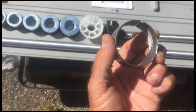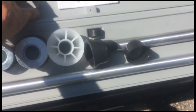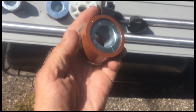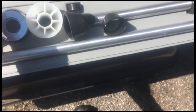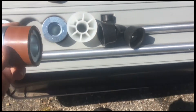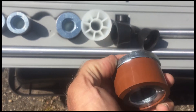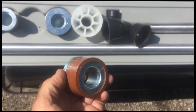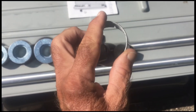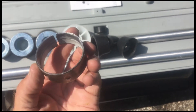These are thin bearings, by the way. There are two types, and for this tool there are two types of seals: the brown for thin bearings and the black for thick bearings. What it does is it leaves less of a lip here that's going to actually touch against the bearing surface to push it in or push them out.